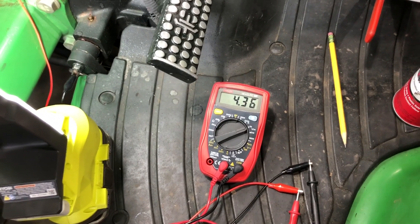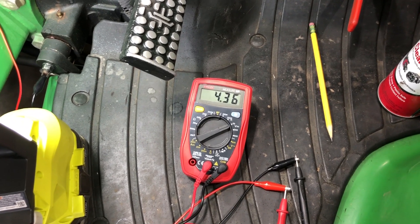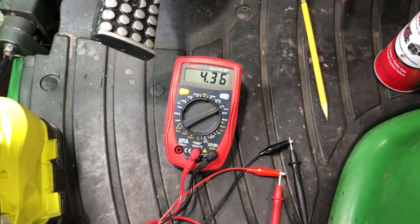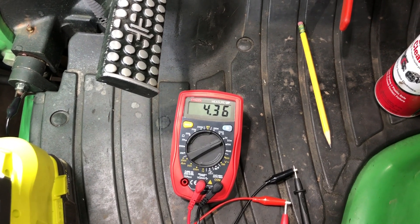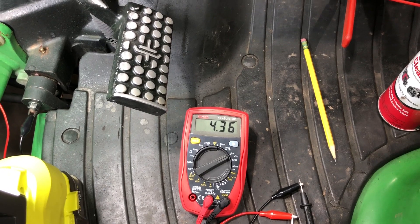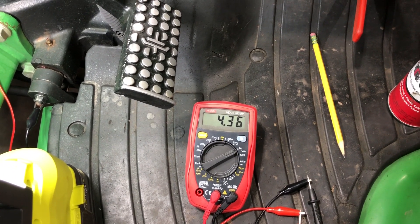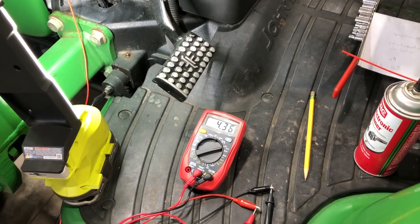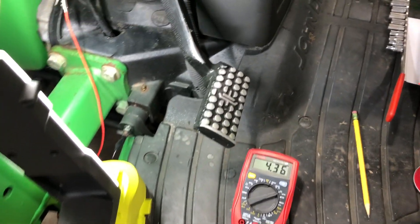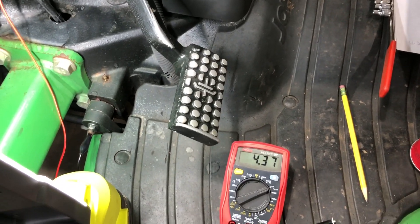The voltage is not going to be consistent, and that's exactly what people report — it goes, it stops, it goes. That's what happens when the voltage is too low. It will stop and start by itself, or if you're going uphill it won't have enough traction in the clutch mechanism because the solenoids aren't open enough. You think the clutch is bad — it's not the clutch that's bad, it's really just a solenoid not opening all the way. That's how this system works on the e-series.